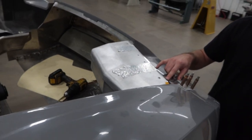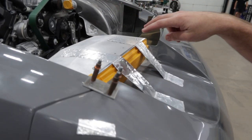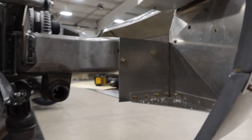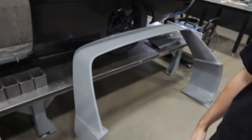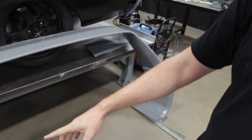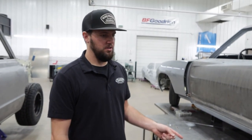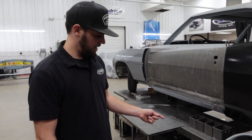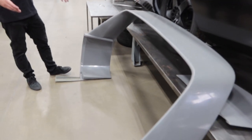Mark is starting to mock up the headlight assemblies — all done in CAD as sheet metal press-brake parts with Morimoto bi-LED projectors inside. Right now it's just rough mock-up with foil tape to get an idea of how to build the brackets and mount them. As mentioned, they're also working on a fiberglass wing mock-up. Rather than 3D printing, all the molds were CNC-routed from foam, and they laid up the wing in several pieces bonded together. Once finished in carbon it will be a one-piece unit.